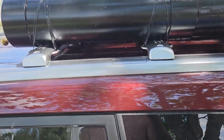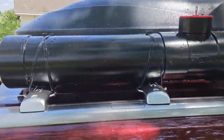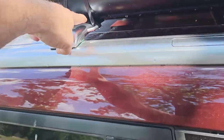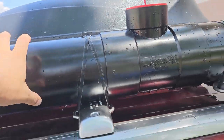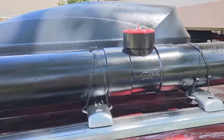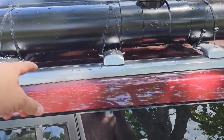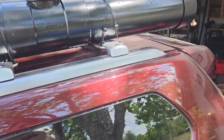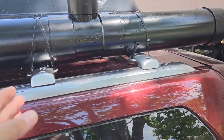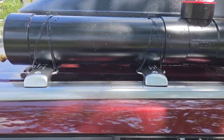The Lexus one's only a little better, so if I was going to do this again I would probably just buy two sets of aftermarket - they're only like 65 bucks. These Lexus ones were 200 bucks, but whatever. I just strapped my tank on here with some big zip ties - that may have to be beefed up later, but I've got it through these little loops so it holds it against the lip there and doesn't want to rock. It's a lot, about 50 pounds of pipe and water right there on the roof. The roof rack will be maxed out once I have it loaded down, but at least the weight is pretty close to the end, which kind of helps not break stuff - but who knows, that plastic might crack. I also had to modify this back bar to make it shorter to make it slide deeper into the mount piece, because from the factory it wouldn't fit that far back. These bars are not parallel - they're tapered, closer together in the rear than the front on these factory rails.